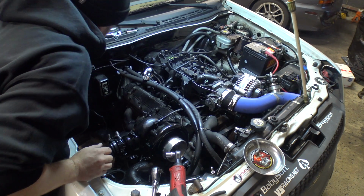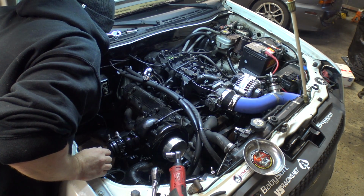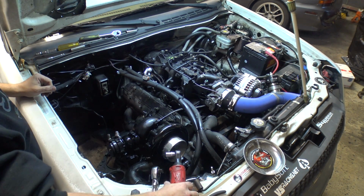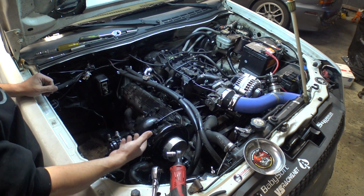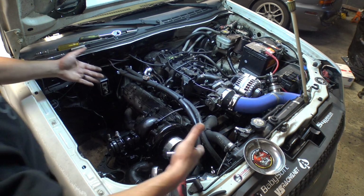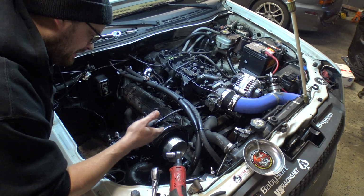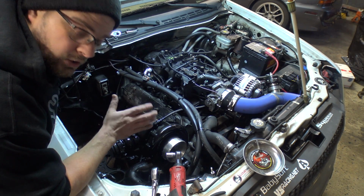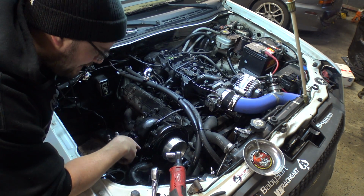There's just small things that I think are worthwhile. So, I gotta go down underneath and dislocate the crossover pipe, and then I'm gonna pull this intake pipe off, and then I'm going to take the turbo drain off, and then I can pull the turbo in one assembly with the drain. Good tip here, if you haven't realized, it's hard to connect the drain to the bottom of the turbo. It's a real big pain in the ass, especially with these smaller turbos that have a really small form factor and a 10 drain.